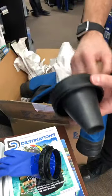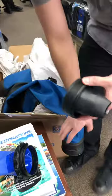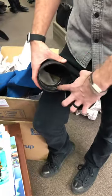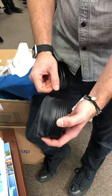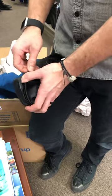This is what you're going to do to replace this seal if it ever goes bad. You can tell that we've got some talc powder on here — that's going to make it easier for it to get pushed back into this securing ring. There is a right way and a wrong way. The correct way is to have that big channel on the inside with the smaller ridges on the outside.